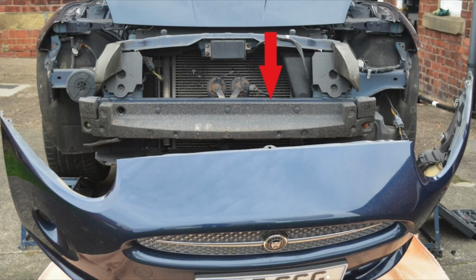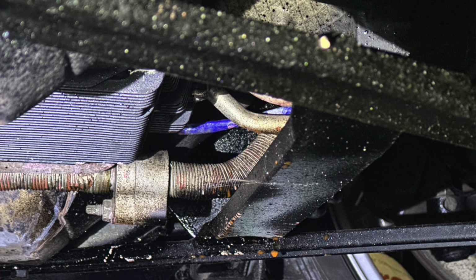Listen out if the cooling fan kicks in, because when it stays on permanently, it'll indicate a coolant issue. And also watch out for coolant leaks under the supercharger in the 5 litre XKR as well. To be really safe, it'd be wise to budget to replace all the pipes in that valley area.